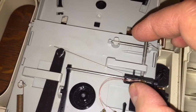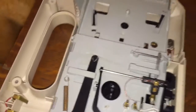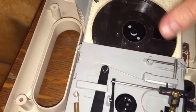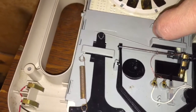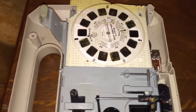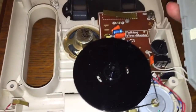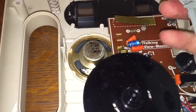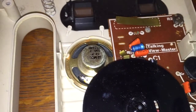When you put the record in through the slot on the top, I'm going to try to do this with one hand — you would insert it here, and that lever down there would push on a little switch to tell it that there's a disc inside, and then it would begin playing. Or in my case, it would begin beeping — that's what this thing would do when we put the record in. I could get it to play, but it would drag quite a bit. There is a second switch near my finger, and if that switch is not activated along with the first switch, the mechanism does not start.